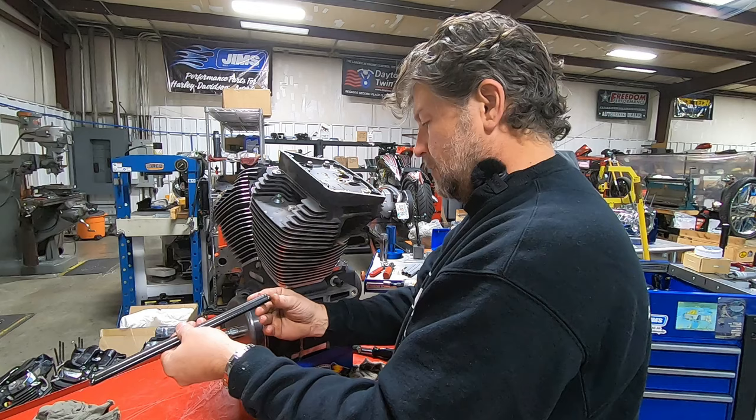We're back from the press. We removed the cams and it does have 203 cams in it, so cams were swapped. Stock pushrods were reused, and that explains why the gaskets were black — not stock gaskets. Looking at the cams here: normal, you can see a little bit of a track mark from the roller, but you can't catch your finger on it.